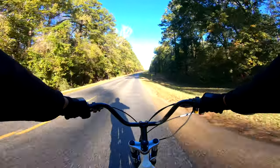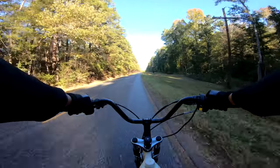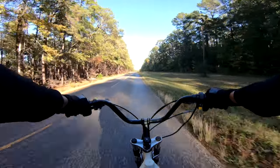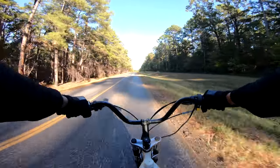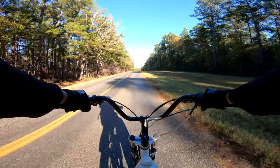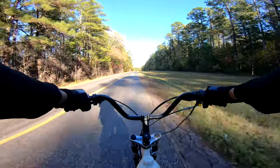Below that, it runs pretty rough. I have a 36-tooth sprocket on here to keep it loaded down. A larger sprocket will put less load on the motor and probably give you even worse results. A smaller sprocket may allow you to run lower RPMs smoother because it loads the motor, but your cruising speed is going to be higher. So really, I can't find a sweet spot on this motor. You're going to be above 30 miles an hour to keep this thing running smooth.